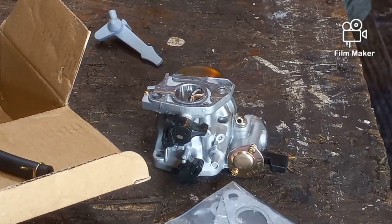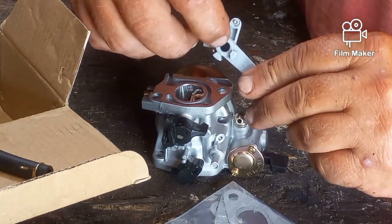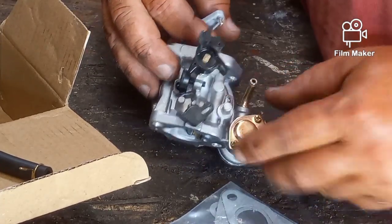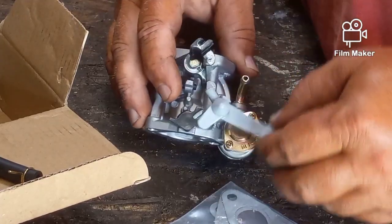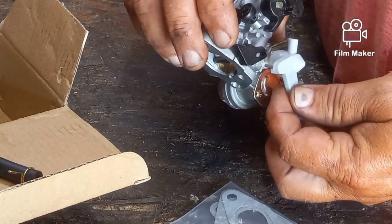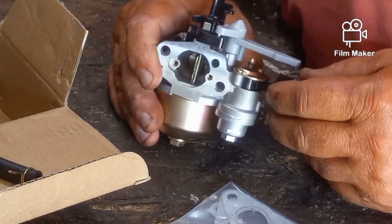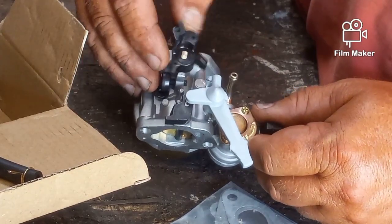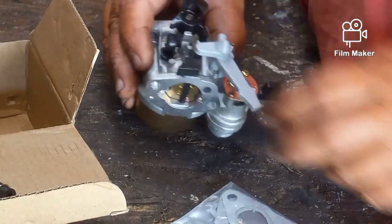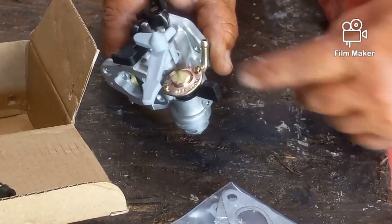All right, on this carburetor, you have this little, this is basically your throttle. Underneath here, there's a space for a post to go in, and then you have this little knobby section that sticks out, and that goes right here. This is the post that this piece sits on. If you put it on there and nothing happens, it's fine. The little post section, in this case it's metal, has a little slot in the top of the butterfly. So if you line that up and put it on there, now when you turn it, it actually opens that butterfly. I think that's choke and run, because if I remember correctly, there is a linkage that goes in here. So that just sits on the top, nothing special. You can pull it off, you can put it on. It's just your choke and your run position. And of course, this is your fuel cutoff. That's built into the carburetor. That's where your fuel line goes on.